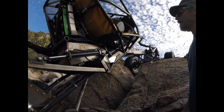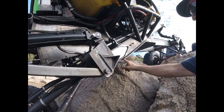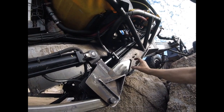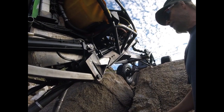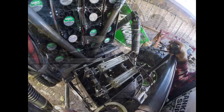I did have one question from a guy on Facebook about how the UHMW works. You can see right in here there's a quarter-inch thick piece of UHMW, countersunk with quarter-inch countersunk bolts — same way here on the sides. You can see where the plate's wearing; that's what it slides in. I ran Rock Dog six years with the same setup and never replaced them. That UHMW is pretty amazing stuff.